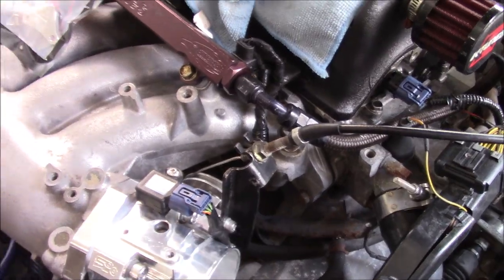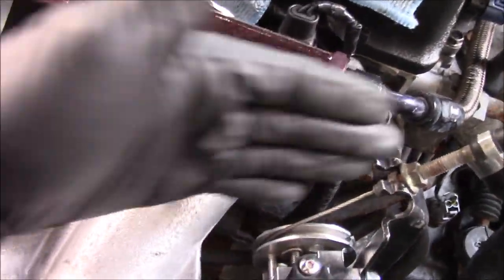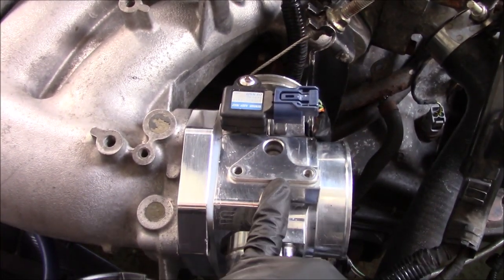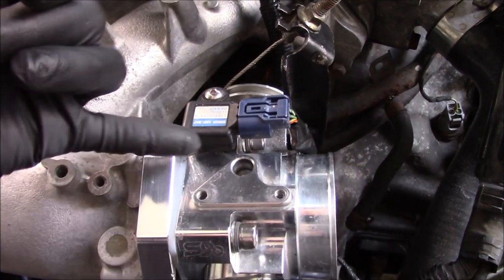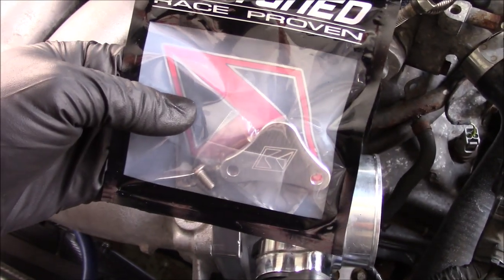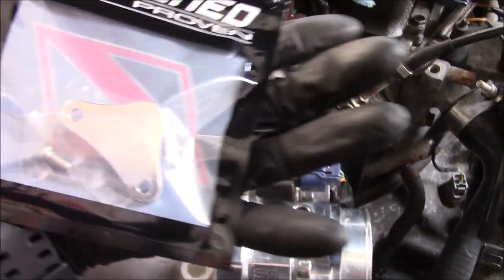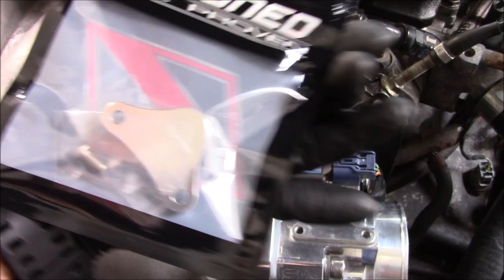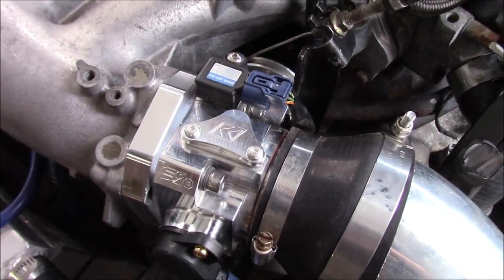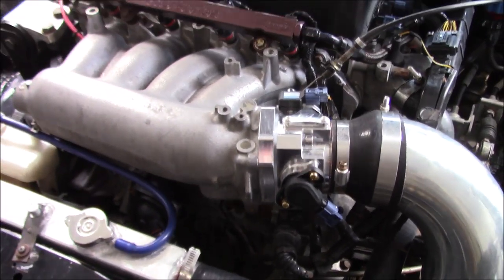We now have the throttle cable bracket back on. I'm sure if he wanted to, he could probably take it off and paint it later. Our angle is perfect and the cable's going nice and straight. Now we have this last port right here which is exposed — this is actually off of stock throttle bodies, this is your EVAP port. Normally you can just put a plug in here, but my guys at K-Tune actually make a block-off port that we can put right here and it's going to look nice. I'll leave the part number in the description — it's an EVAP block-off port for exactly this. Yo, look at that — it just looks so much better. It looks more complete. It goes with the whole billet theme.